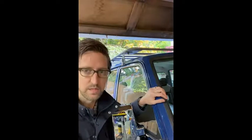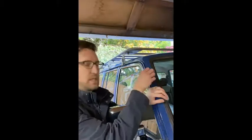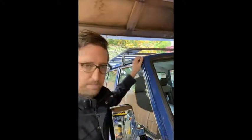And then it's always a good idea to go back over your area before you paint with some tack wipes. And the trick with those is, you can ball them up and just kind of run it really lightly over the area you're gonna paint. Don't put pressure on that stuff because it's coated with the sticky material to catch all those fine fibers. So the trick with those is you don't really have to rub. It's just gliding it over to get all that dust out from this area here.